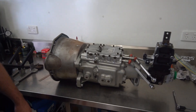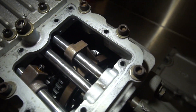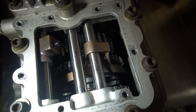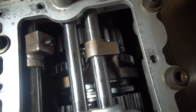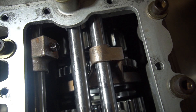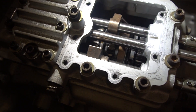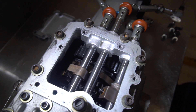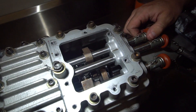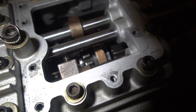I'll actually open it up so you can have a look inside. You can see it's got straight cut gears. You can see how the dogs engage on each other - there's a backwards taper on the dog which holds it in place. I'll give it a shift to see if I can get this thing to shift gears, because it's actually in gear at the moment. There you go - that's in neutral now. Here we can spin the gears the other way - that's the output shaft, that's the input shaft spinning. Now that's engaged into what looks like top gear - you can see the dog now engage down here onto the backwards taper.